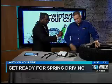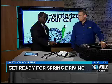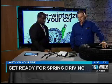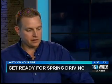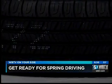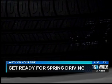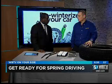Let me ask one more question — rotating the tires, how important is that? People don't do that as much as they should. It's very important. This particular tire has a 65,000-mile tread life guarantee. You want to ensure you're going to get the most life out of your tires, so make sure your tires are rotated, aligned, and balanced. Try to get your tires rotated every time you get your oil change done, which is about every 5,000 miles for most cars.